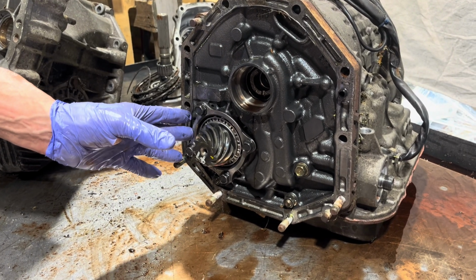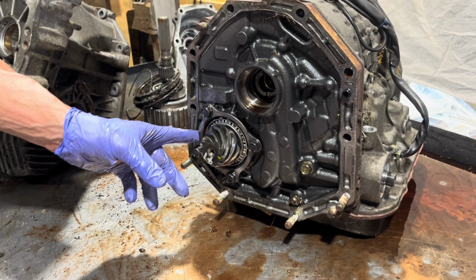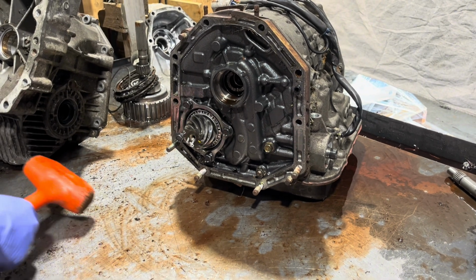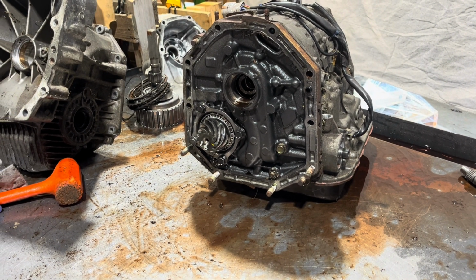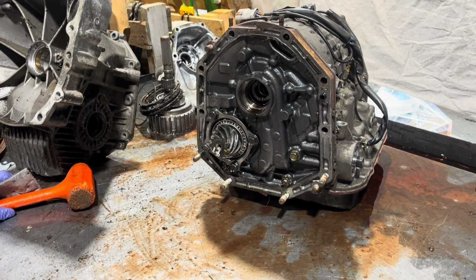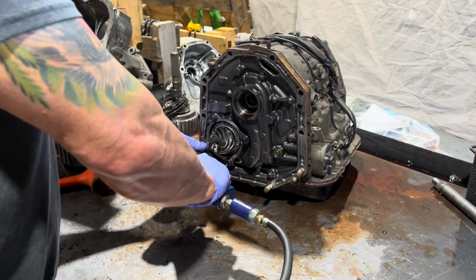And further to that, the seal has a housing, kind of looks like this. We'll show you on the other side, but there's an O-ring that's under there too. And that thing sometimes gets hard like a piece of uncooked linguine in there, and it doesn't really seal too well at that point. That said, let's keep going. Some more 14 millimeters.